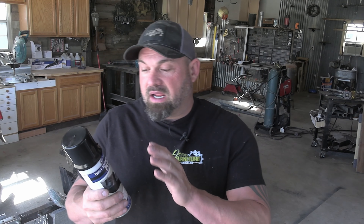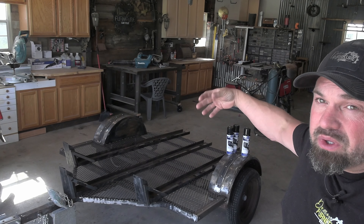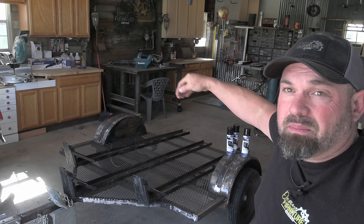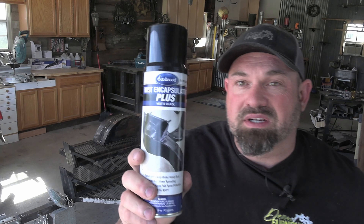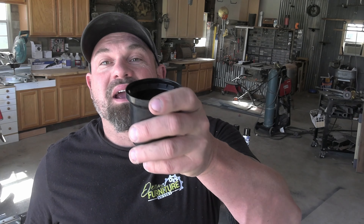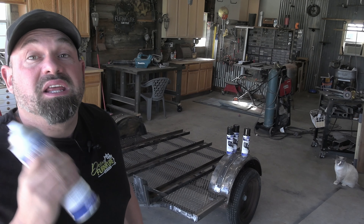If I was doing a classic car frame today I wouldn't opt for the aerosol — I'd actually buy a quart of it, take a paintbrush, and paint it on real thick and heavy. But with this trailer having all this expanded metal, small parts, and tiny crevices, it'd be really hard to get in there with a paintbrush, and as you're painting expanded metal it's going to fling paint everywhere with a ton of drips hanging up in between every groove. We're not messing with that today — just going straight to the aerosol, make life easy, put a nice coat on there, maybe two coats. Now even though this is the aerosol version it still applies very thick — a lot thicker than normal aerosol paints. It can potentially clog up the nozzle, so Eastwood drops a second nozzle in the cap for you just in case. This stuff is very thick, not like normal spray paint, so spend the time to shake it up really good.